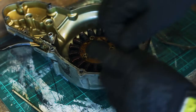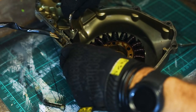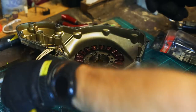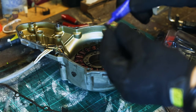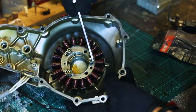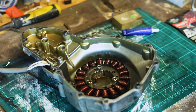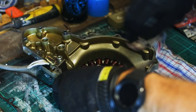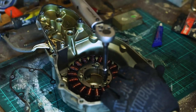We're also going to clear up all the excess adhesive. This bolt here is just a little cover that holds the wire in place, and that will just drop out. We're going to use a little bit of medium strength Loctite to ensure that they don't undo — three bolts and the little one that holds the cover in place. Clean up these surfaces. The service manual recommends using a little bit of brake parts cleaner: spray it onto your rag and that's going to clean that surface up really nicely without leaving a residue.